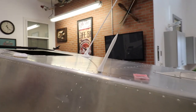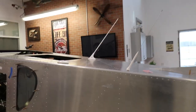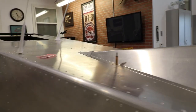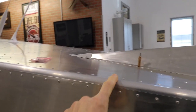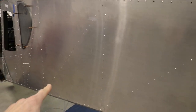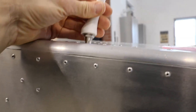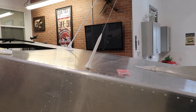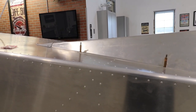Another example of thinking ahead was with my ELT antenna. I wanted to have it mounted a little further back on the fuselage, but I was worried about the access hatch on the bottom — if I put it too far back, I wouldn't be able to reach it from inside the airplane to install the nut or the antenna cable. So I waited until the airplane was built enough to see how far back I could actually reach, and put the antenna in that location.